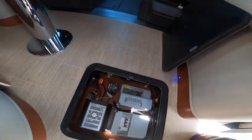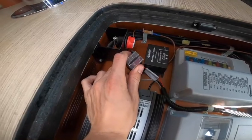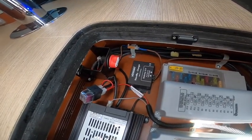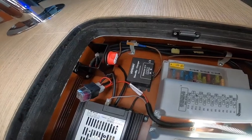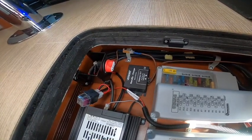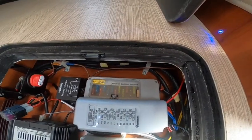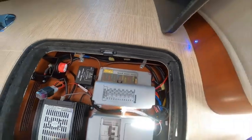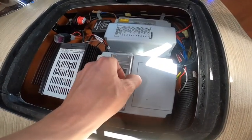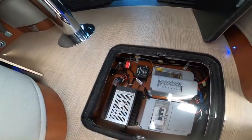Underneath the hatch in the double floor by the lounge, just under your table, you have your main battery fuses and an isolation key for your leisure battery. If leaving the van for a couple of weeks, turn the key to the off position to stop any drain on the leisure battery. There are all your 12-volt fuses — carry spare blade fuses as it tells you what does what and what amperage is required. You also have your main trip switch and MCBs on mains 230 volt — try the van before trying your main site. And that is your charger unit to charge the battery.